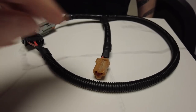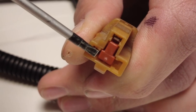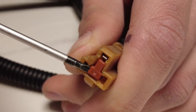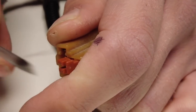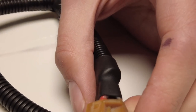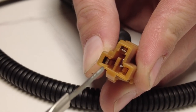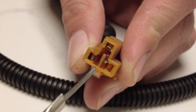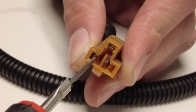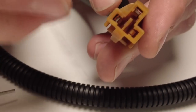This is the same connector as in the car, so Tyler's going to demonstrate. There's a little insert — a little reddy-brown bit that you can remove. What you've got is little plastic springs that point towards the outside and stop the pins coming back. Tyler's going to get in between the pin and the plastic thing, lever this way to force the plastic spring towards the middle, then pull on the wire and it should come out. Go for it Tyler.